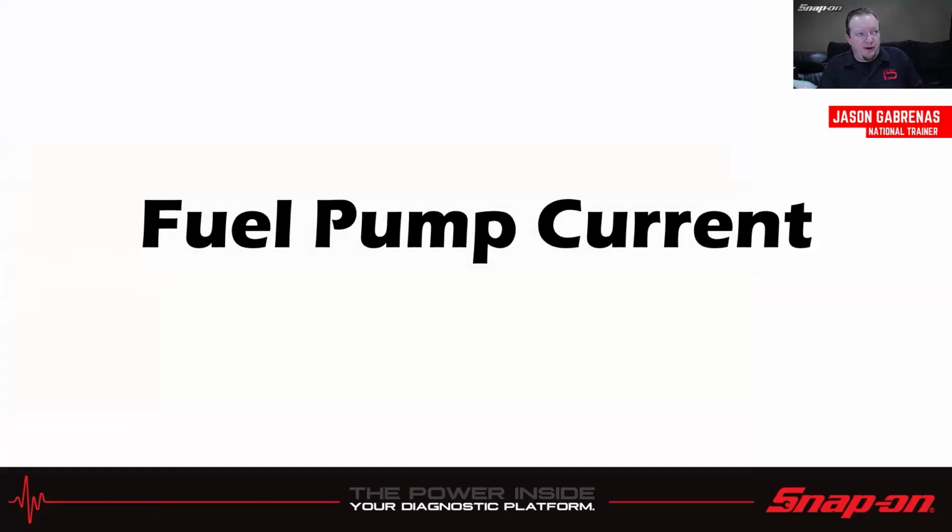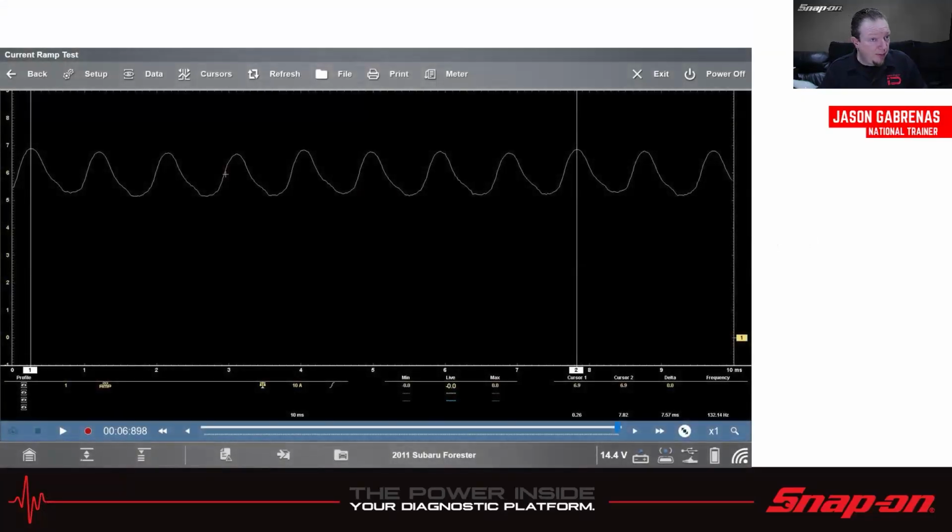How about fuel pump current ramp? That is a very helpful test to do to check the condition of the pump itself internally, as well as check the speed of the pump. So speed is critical to drivability. The pressure of the fuel is dictated by the pressure regulator, and the volume of the fuel is dictated by how fast the pump is turning.